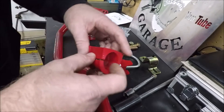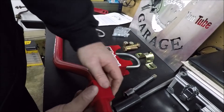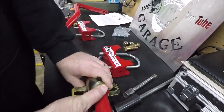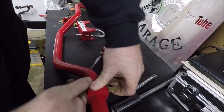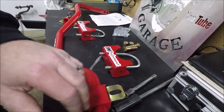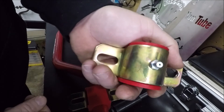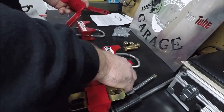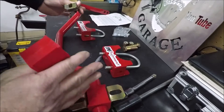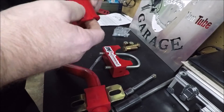The next thing we're going to do is install our bushings onto our anti-roll bar. This is pretty easy — you pull it out of the bracket, it splits open, wrap it around there, set your bracket back on. It should be kind of firm fitting, and it's going to spin around and mount upside down like so. You're going to lube these after you install them — it's got little grease zerk fittings. I'm going to go ahead and smear just a little bit of grease in here so they don't bind up until I get a chance to lube them permanently.